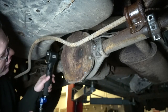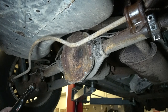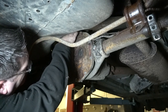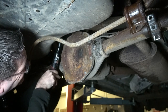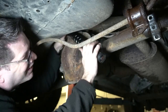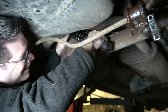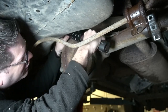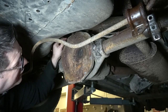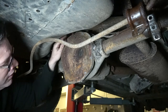The Astro air ratchet was great, but still too big to reach the upper bolts — means back to a regular ratchet. Our top ones we're going to need to do the old fashioned way. These aren't bad once you break them loose. I've got two still connected up top, pretty much finger tight. We're going to chisel our cover off and drain our fluid.